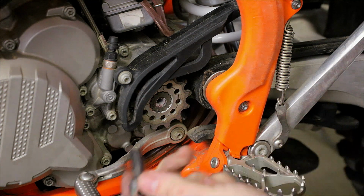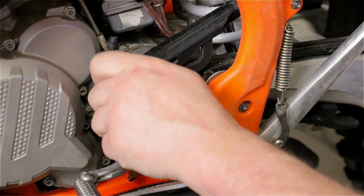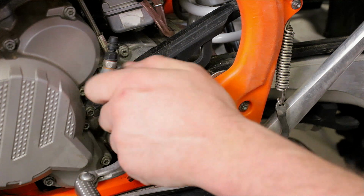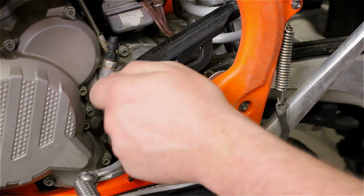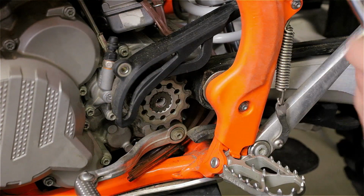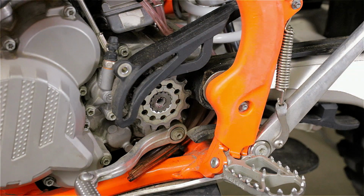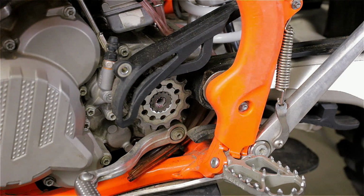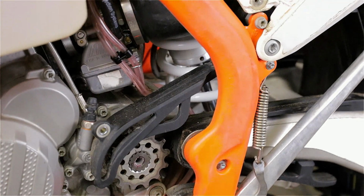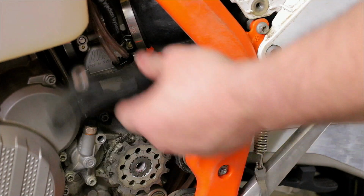And I'll use an 8mm socket to remove the chain guide. Now my other bike, I only removed the front part and I lifted it. There are 2 bolts holding this. And yeah, I can just loosen the other one, which apparently is not an 8. It appears to be 8-10mm. Let me just put it in view. It's right here. And this one is a 10mm. I'll just loosen it a bit and I can move the whole thing out of the way.